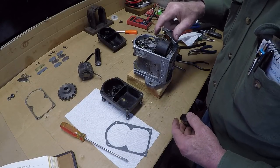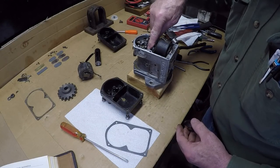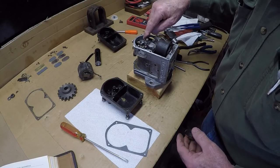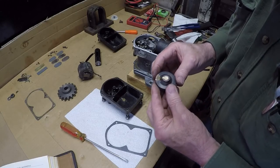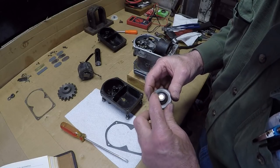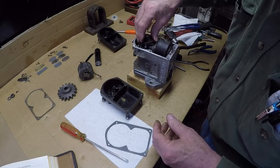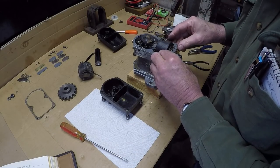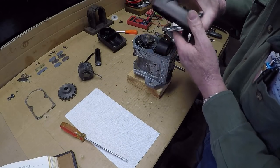Now we've got everything fastened down — clamps on the coil. I took a plier to snug that first nut. Got the coil wire, the breaker wire, and the top terminal all snugged on. Checking the rotor — I'm real happy with how that looks. Get the rotor seated in, get our gasket on, and everything in the brushes looks good. Next up is the magnet — the last step of this rebuild for the most part.